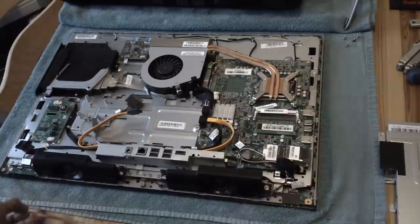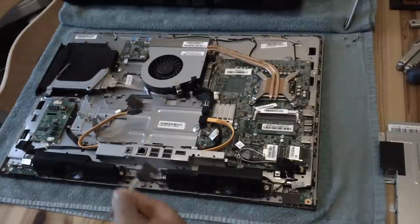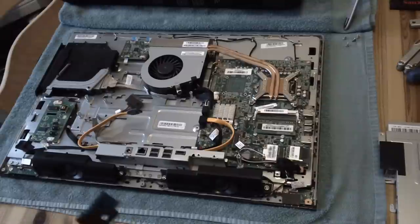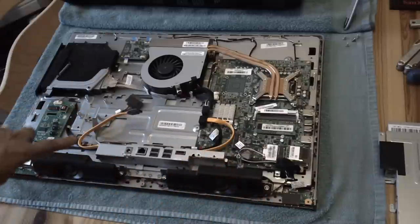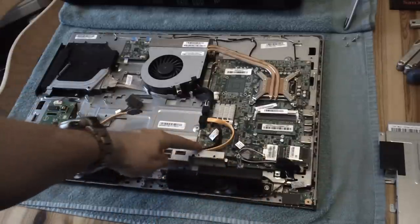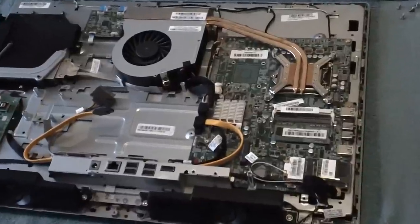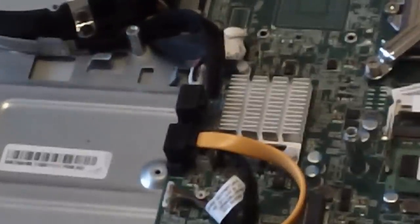The computer is all in bits at the moment - we'll discuss putting it back together in a minute. The cable that attaches to the hard drive is a combined SATA data and power cable which then splits into two very thin leads. They are fed from one end all the way down, and if I zoom in you can see the two SATA connectors.